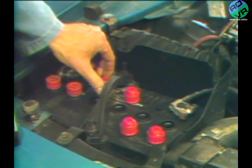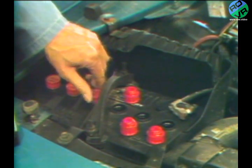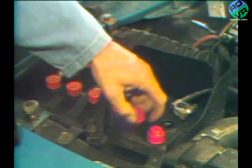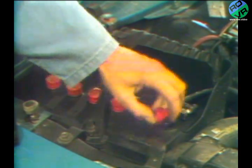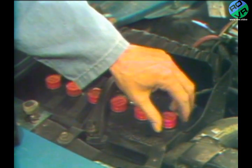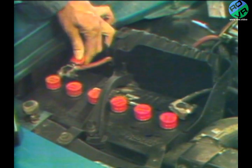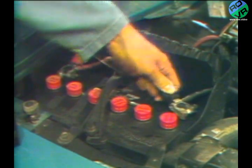Another situation that can occur in the field is an overcharging electrical power supply system. This is not a chronic or even a common occurrence, but it can happen. If a battery uses a lot of water and an owner complains of a won't crank condition that is almost immediately corrected by a proper filling of the battery, you can safely suspect that the charging rate is much too high, probably caused by the regulator points sticking to deliver full field current to the alternator at all times it is in operation. We can check out this possibility with our voltmeter setup.